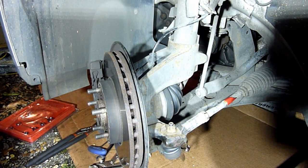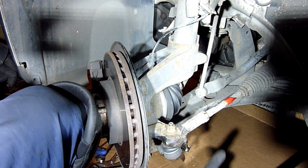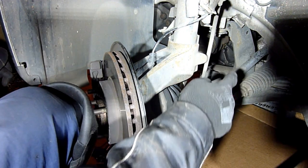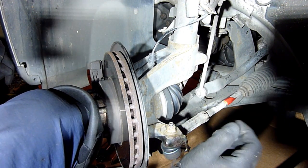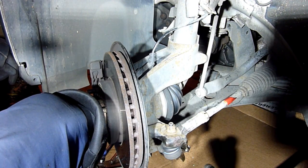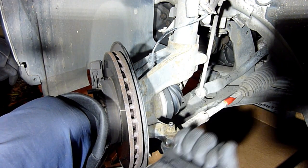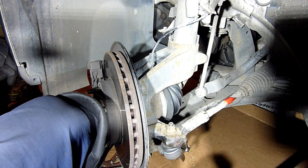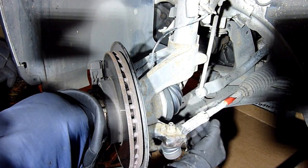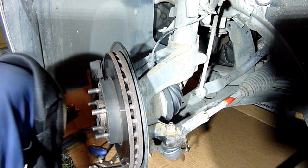Maybe we'll change that — we'll see. I made a mistake earlier. Just to finish this video: remember I said whacking it might undo the inner tie rod from the steering — it actually wouldn't, because on the left-hand side going to undo it this way it's going to tighten it. It's only on the right-hand side if you undo the nut the same way that it could come loose. So no worries about it. I couldn't find the spare nut — that'll be another video. I have got it somewhere and I will change that nut at some point.